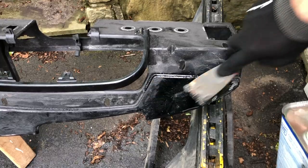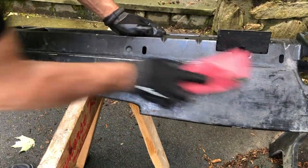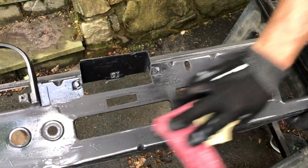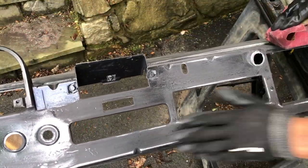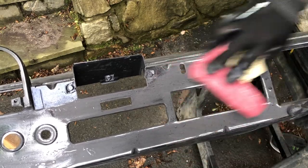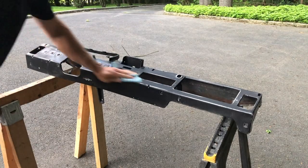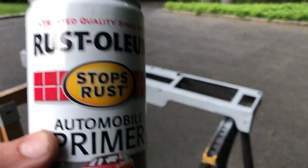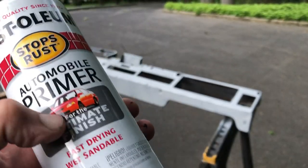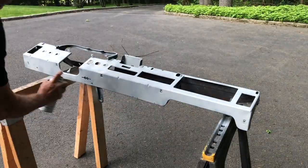You really don't want to take this out of the car once it's in. Now most of this is going to be covered by the dash material, but there may be a few areas where a little black will peek out. So I'm just going to clean this up and shoot it with some rattle can satin. I'll hit it with a tack rag and use some Rust-Oleum primer here, mostly on the areas where I sanded through, but I'm just going to give a nice overall coat. Now that we have a fresh clean slate to work with, let's start with the upper dash pad.